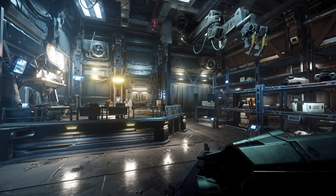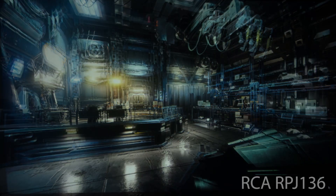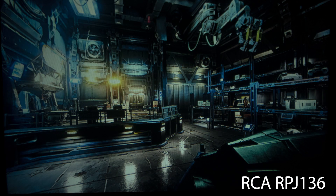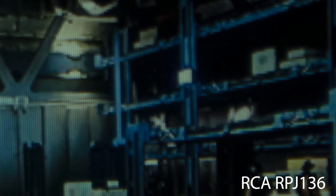For actual content, this is a screenshot from the game Star Citizen. I didn't want to use anything from an actual movie because YouTube has been going a little bit crazy, and especially with this Europe thing going on, I don't want my video demonetized because I used a single frame from a movie. This is a screenshot from Star Citizen which we are allowed to use, and this is the actual source file — not a picture of the projected image. Now this is the image as projected from my Mitsubishi HC-4000 projector, using the same manual settings on my Nikon camera. And for comparison, here is the same image projected from the RCA projector. It's the same image size, but it is a lot dimmer and the resolution is starting to suffer here. Zooming in on one portion, the Mitsubishi shows great detail, but with the RCA projector you're noticing a huge loss in detail.